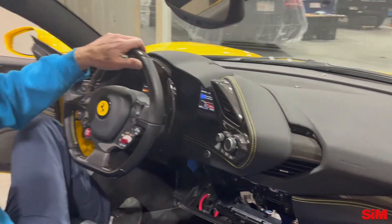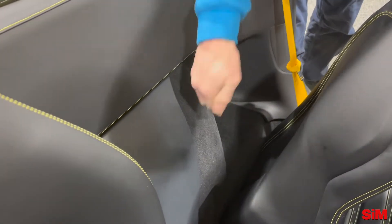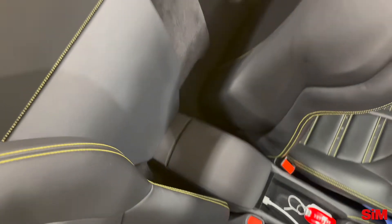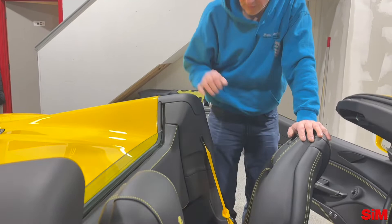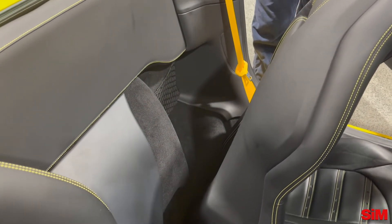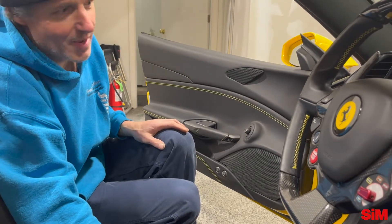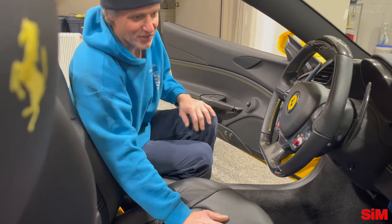The transfer function of how the subwoofer works — it actually backfires this way, loads off of this panel, and then vents down and out of these two vent holes here. What that does is create a transfer function of how the sub reacts to the cabin inside. We like to do a lot of ported boxes because you get that natural amplification, and this worked incredibly well because you mimic the way it loads off the back panel to bring the bass out front. You also don't see anything, you still have some storage space, the two pockets behind the seats still work, and with the seats back it's completely out of sight. We did some sound deadening in the door to get the resonance out, and other than that the car is pretty tight anyway — this thing is rock solid.